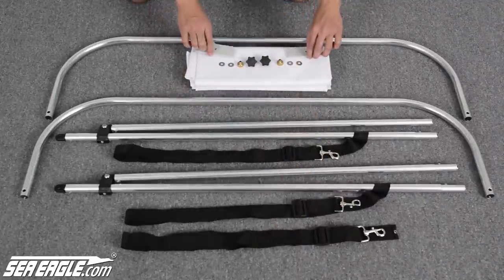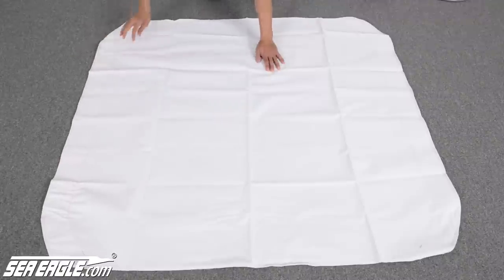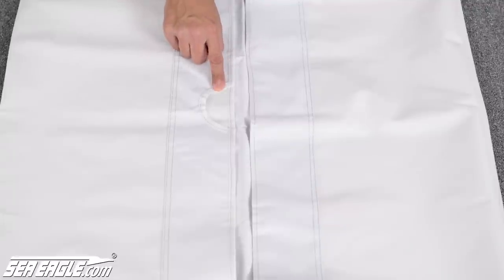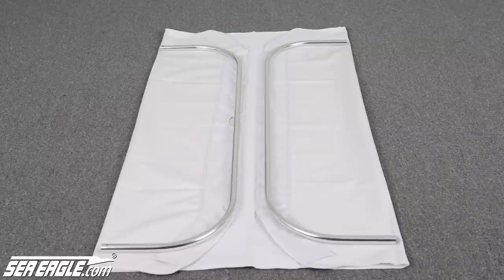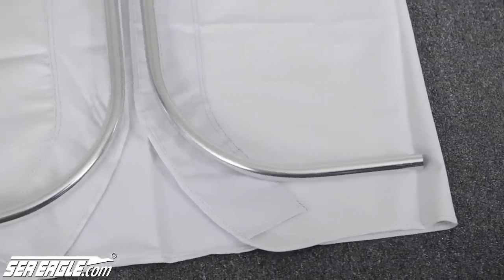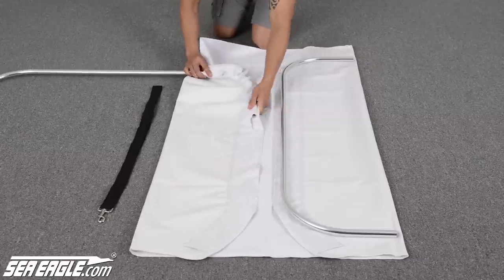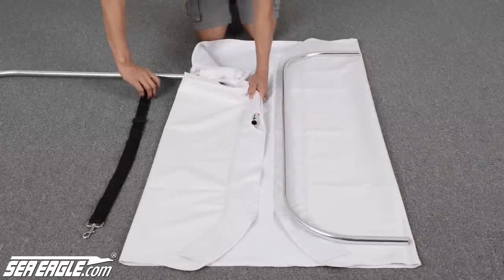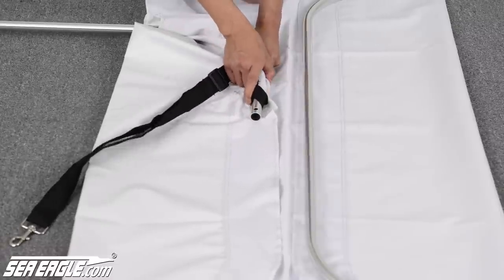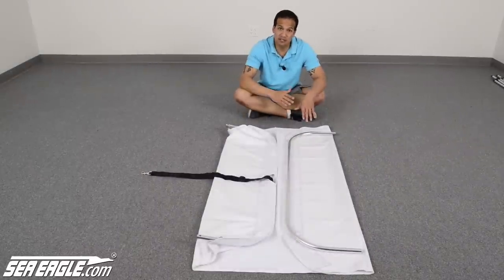For the SE9 you will also have two additional brackets and two bolts. Unfold and lay out your canopy with the rough side up and the smooth side down. Grab the ends and fold them up towards the center. Note that there is a cutout on one end — you'll want this to face the front of your boat. Lay your U-frames in line with their sleeves respectively on top. At this point the pre-drilled holes should face up towards the front of the canopy and face down towards the rear. Take the front U-frame bar and push it through the front sleeve until you can see it at the center cutout. Locate the strap, slide it onto the U-frame, and continue feeding the U-frame through the front sleeve. Now repeat that step on the opposite side, minus the strap.